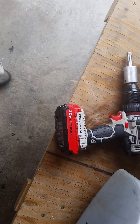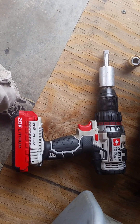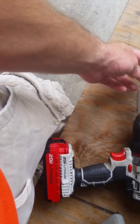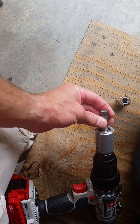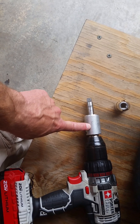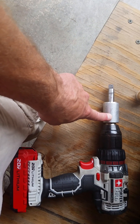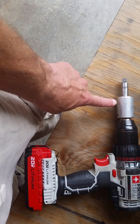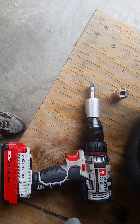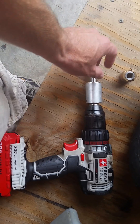This is what we came up with for an electric starter for our CR125 shifter carts. This is a one-way bearing from a Coleman cart starter, with a 3/8 inch drive extension put in the end of that bearing. These were about 40 bucks, but I've since found one-way bearings for five or six dollars online and at a local bearing supplier — it's just a matter of doing a little machine work to make them fit into the drill.